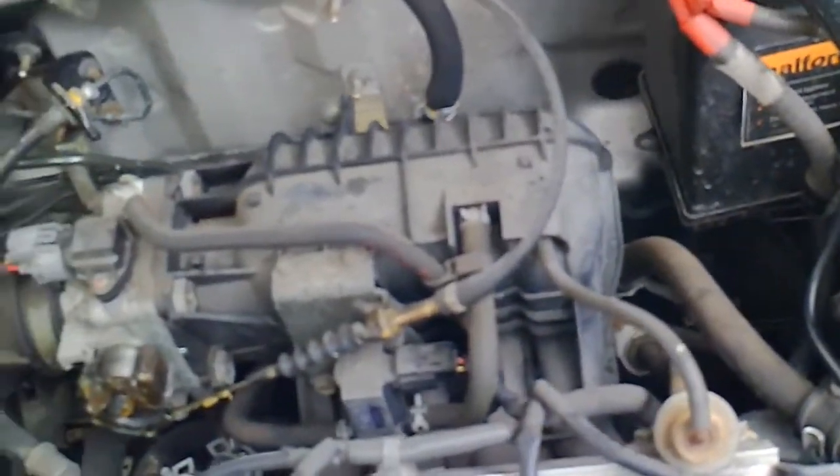You need to rub some of this grime away. If you've got a bad earth then the test light won't show up as I showed you. I'm resting on rust so there's no light coming up. Go through the rust — there's your test light, there's your light coming up. This is just a basic video on how to find an earth before putting your car in for a garage. If you've got a poor ground and you've got a light, take your ground off, give it a good clean and put it back.